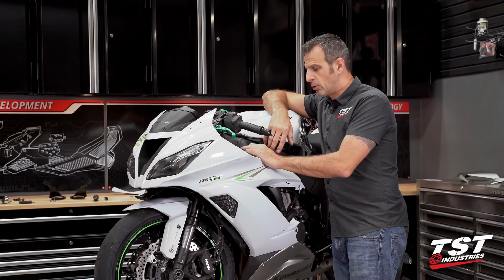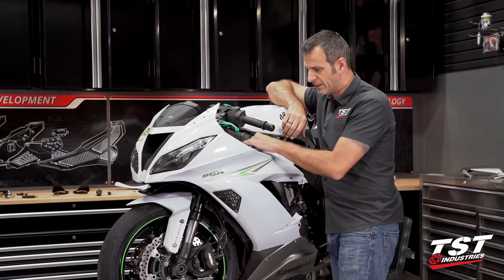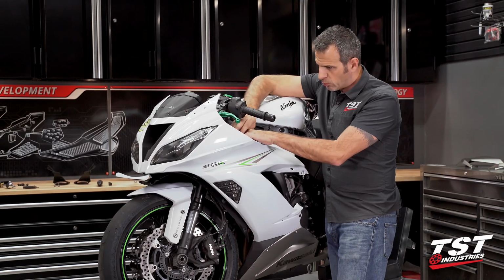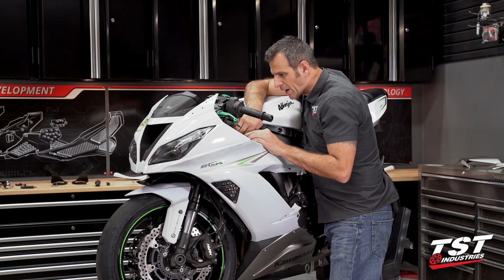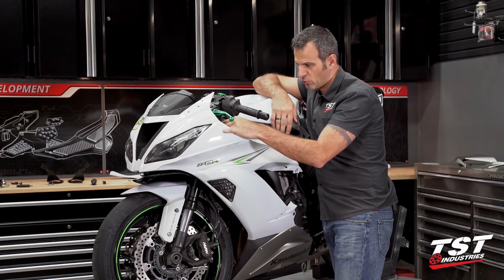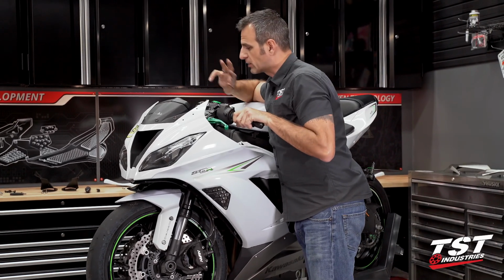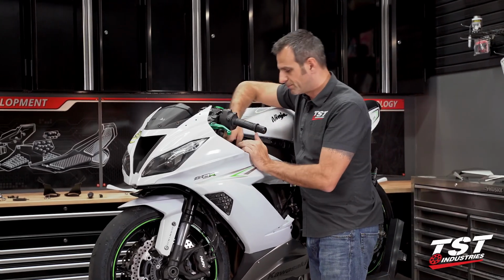At this point, I'm going to reconnect all of the connectors that we dislodged on this side, then hop on over to the other side. First, I'll do the rectifier here because it's easiest. Then the 3 connectors that came out of that boot will be reconnected. I will be putting those 2 wires from the headlights into the routing guide, sliding the boot over, then finally replacing the fuse panel here beneath this area. Hop on over to the other side. The only connectors that we took out were the 3 connectors in the boot. I'll do that there, and then we'll proceed to the rest of the reassembly.